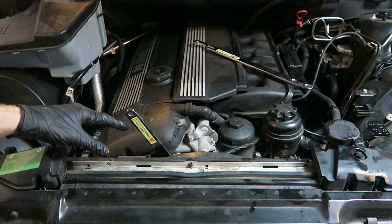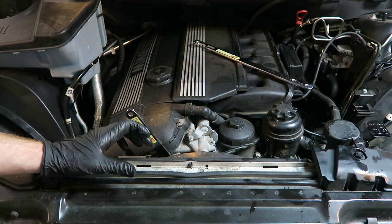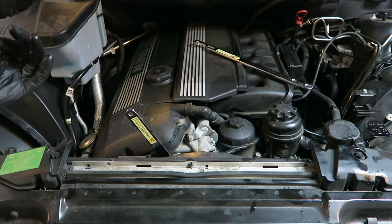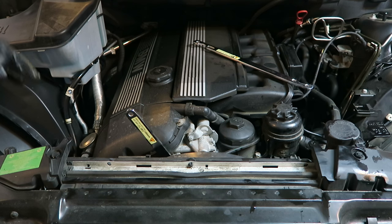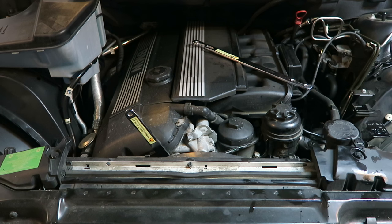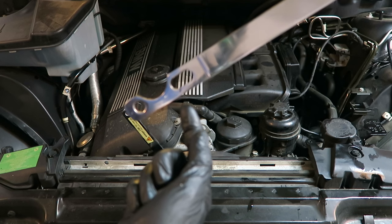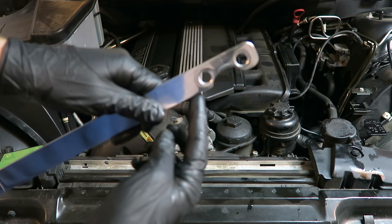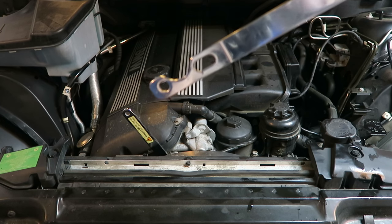In order to fit these tools in here and hold down the bolts on the water pump pulley, I like to remove the upper radiator hose. I know a lot of you disagree with that, and it's an unnecessary step to open up the cooling system, but in my past experience it's the easiest and fastest way to access everything you need to get to. That upper radiator hose is just one more thing in the way to make removing the fan clutch that much more difficult. I also find that using the slotted end of this tool is the one you need to remove the fan clutch — this other end is a bit shorter between the two holes, so this is the end you want to use.